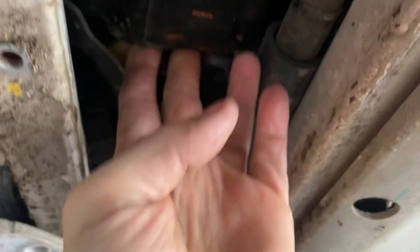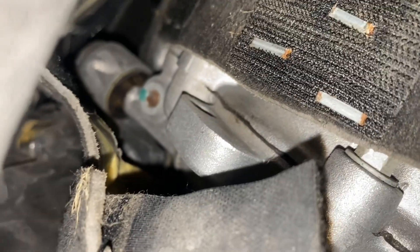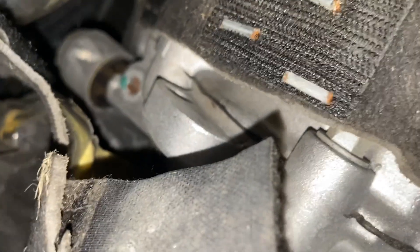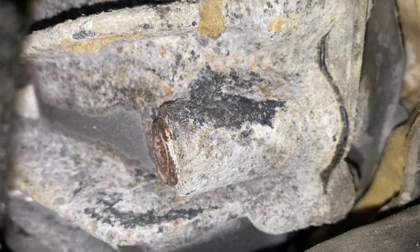I just took a pry bar and wedged it out of the way, and I can see the front drive unit now. I've got to split this velcro casing to get to the drain plug and stuff — what a weird design. The fill plug is really the doozy; it's way up there and I can't even reach my hand in there. Drain plug is way down here. There's definitely been plenty of salt water on this bad boy.